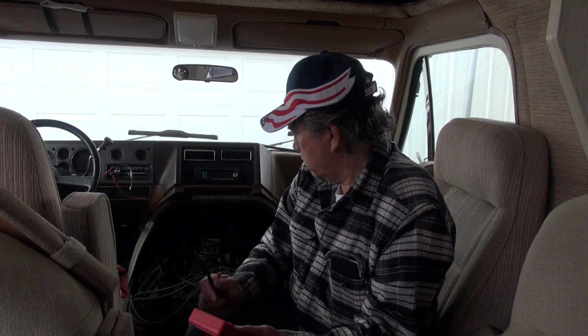So the first thing I wanted to do, since I did all the basic stuff just not too long ago, I thought, fuel, well, it's throwing out too much fuel. 27 years on that TBI, which is a throttle body injector unit, probably needs new gaskets. So I did that. I did the throttle body gasket kit, not the injectors, that's a fuel pressure kit also, and 2 electrical components that are on it.